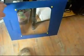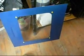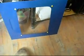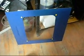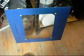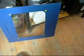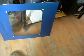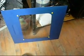And also have a little update on the side cover. The adhesive that we used to attach the plexi didn't hold very well, so I ended up taking it all off and drilling holes through it and putting some bolts and nylon lock nuts on there to keep it tight so it don't rattle. And actually, I'm kind of glad I did that, because this way, if the glass gets scratched or starts fading or whatever, and you want to replace it, you can just undo the 4 screws, buy another piece of plexi for $3, and have a brand new window again.